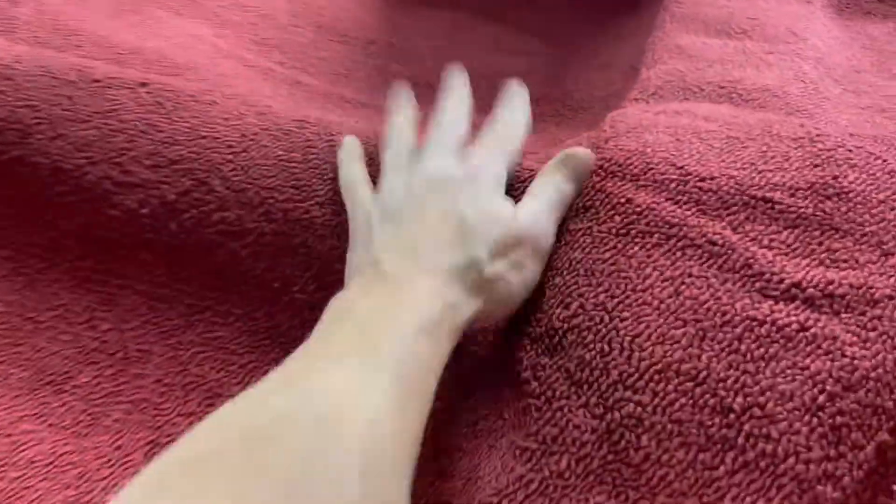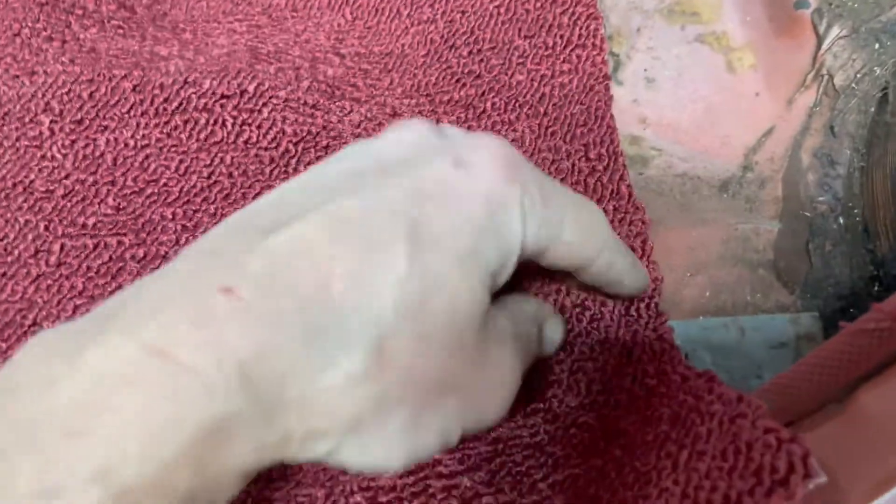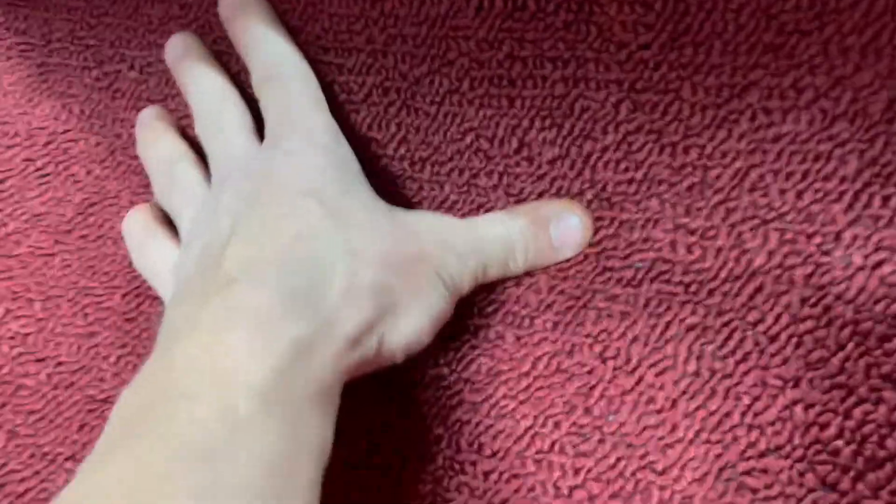I bought preformed carpet from eBay — Auto Custom Carpets is what everybody sells, and it fits pretty well, actually better than what I normally see. Part of the trick is to get this stuff out and let it relax — open it up and let it sit on the roof of the car or something like that. One thing I want to be careful about back here is I don't want to cut it too short, because the carpet reveals somewhere around the back seat area. But before I cut it, I want to start making holes for the seat belts.